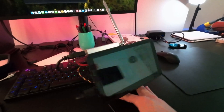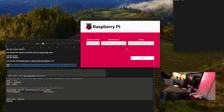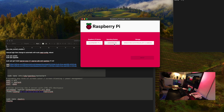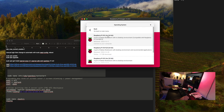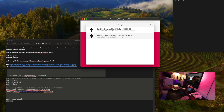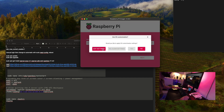I'm still using the MacBook power brick with the MacBook cable. It seems to work okay, but I'm still waiting on getting that Raspberry Pi power supply delivered. So with that being said, let's dive into the software setup. We've got the blank USB stick inserted, we've got the Raspberry Pi imager loaded up, and we've selected Raspberry Pi 5. For operating system, we're going to choose Other, and then we're going to choose the 64-bit Lite OS. This has no desktop environment.